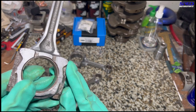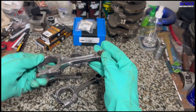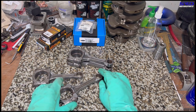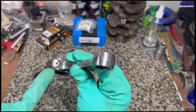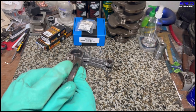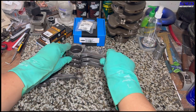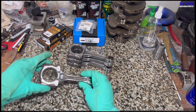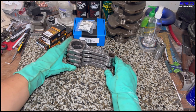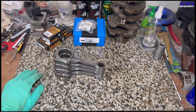Here you can see number two stamped on the rod. Also note these are factory rod bolts that stretch — that's a good thing, and that's only on Type R engines. You can click the rod bolt stretch video we did previously — it'll be in the description below. We also have B-roll of Honda factory assembling the Type R showing how they stretch the bolts, and there's the ITR crank of course.